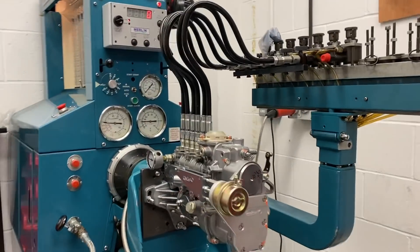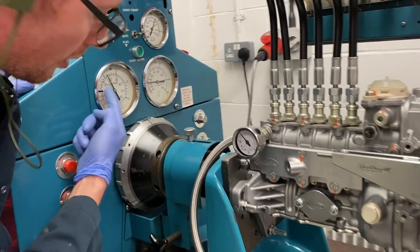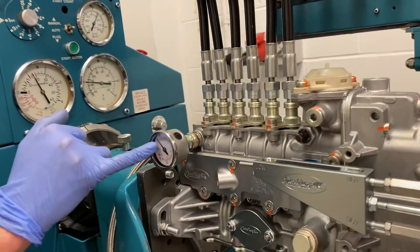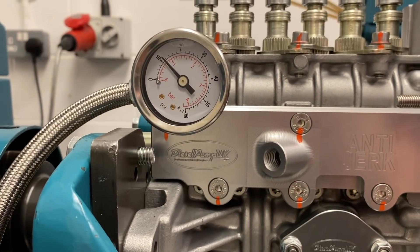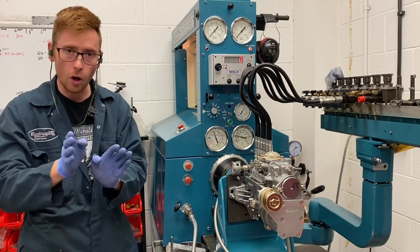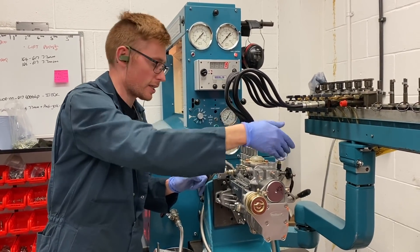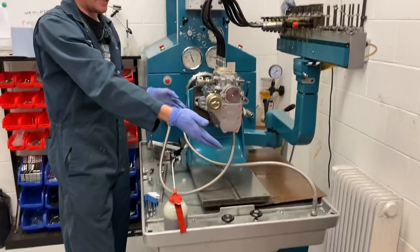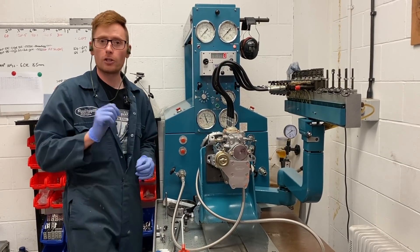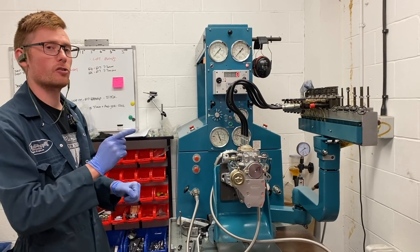Let's have a look at how the gauge works, because that's what we're talking about today. We're going to turn on the fuel pump test bench — there'll be a little bit of noise. We can see two readings here. My bench is saying we're doing about 1.2 bar, and the gauge is reading less — one bar. The reason for that is the pressure drop across the system at different points gives two different readings. That's why it's so important to have a gauge on the actual item you're reading. It's pointless to have the gauge after the return or at the start of the pipe — we need to be measuring at the pump. So let's see what happens when we give this mega 210cc fuel pump — a 600-plus horsepower fuel pump — full throttle, and let's see what happens to that pressure.